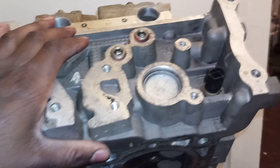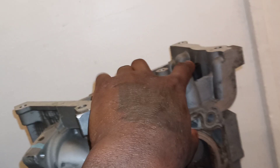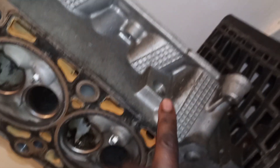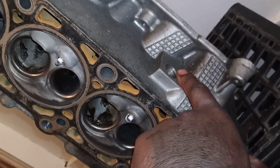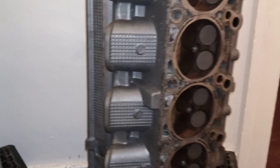And another thing for any Crown Vic guys with a 2005 and up — this is why I say make sure to get an Aviator head, or make sure the Cobra head you're getting has that fitting right there, because that's going to make your life easier — definitely in a 2006. These heads are going to make your swap and your wire harness a whole lot easier because this is the head cooling temperature sensor, which is on this head right here. You need that. You'll be able to simply pull the harness and this sensor, and it will basically bolt up with your harness, which will allow you to run these heads. The computer is able to monitor the cylinder head temperature for these heads.